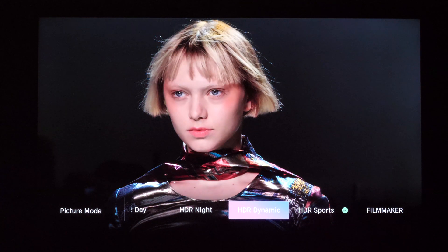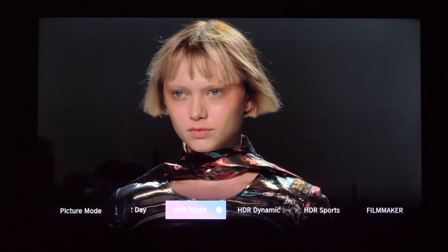No such issues with gradations. For HDR night on this TV, white balance values are copied from SDR to HDR10 and Dolby Vision for the same picture mode. So HDR night is taking values from the night SDR calibration which I did. And here also, skin tones and gradations are not looking correct.